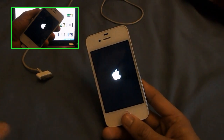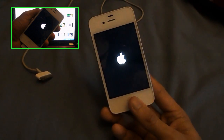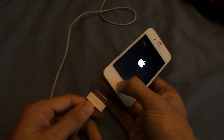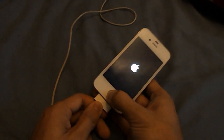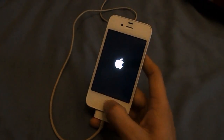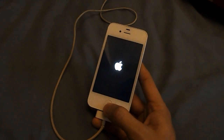I have got proof of this actually working because I did make a video of this before, but that was how to get out of recovery mode. Then once it's like that you hold the home button and go plug it into your device, and then from there your computer will say it needs to be restored as it's in recovery mode, and then it's pretty straightforward from there.